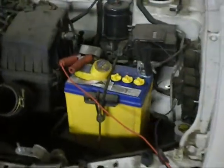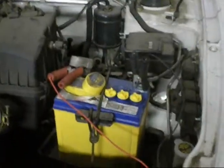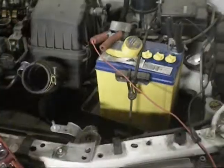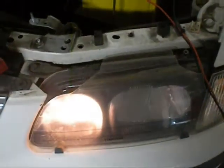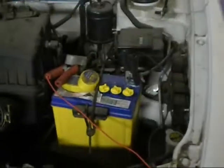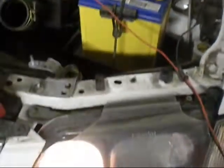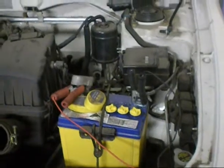If you can charge a battery connected, just don't let it go over a certain voltage — normally 14 volts is the limit. If you've got the lights on, that'll help as a load and get the charger to work better too, as the battery's not actually pulling anything. When I put this charger on it said the battery was full, which means the battery's stuffed. This only works if you have a charger that's at least 4 amps more than what the parking lights will take — you need at least 6 to 10 amps to do this.